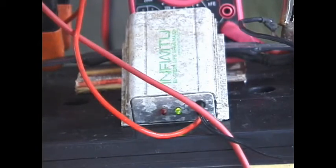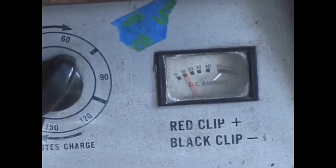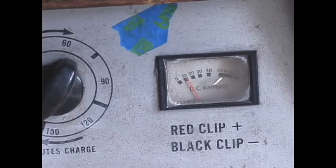Initially, if the battery is completely dead and has sat for a long time, I would use a high-amperage voltage charge to start it going — it may take hours. Any reading on the charger showing some amperage being delivered to the battery means it's starting to charge. In this particular case, the charger has started to get up to 10 amps. If it won't take a charge, use jumper cables to a good known battery, start the charger charging for 15 minutes, then disconnect and see if it will charge on its own. Some chargers won't charge a battery they can't see, and often can't see a battery with less than 4 volts. Once it starts charging, lower the amperage setting and let it go for 8 hours or so.